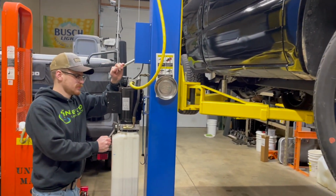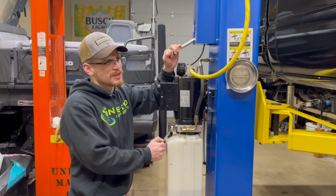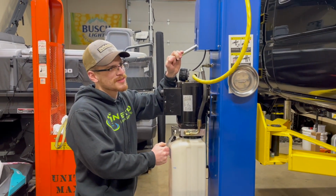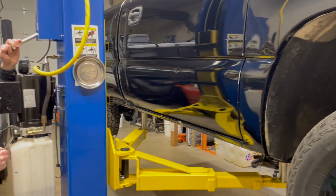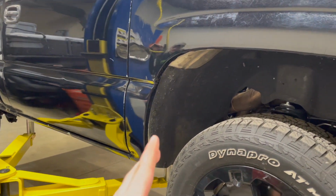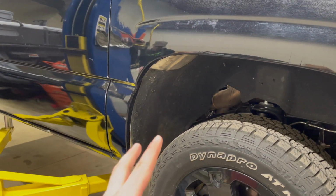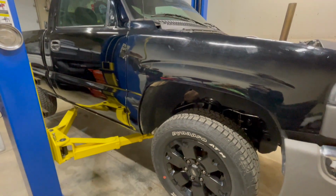All right, Bailey, what do we find underneath there? Oil's coming from somewhere. It could be rear main, could be cam sensor, O-ring leaking. Yeah, we're not exactly sure. So we pulled the flex plate cover off, and you can't get it off with the On3 crossover, which is a whole problem in itself. Another good reason not to buy an On3 hot side.